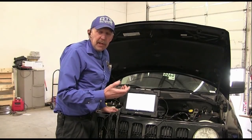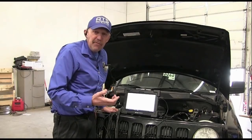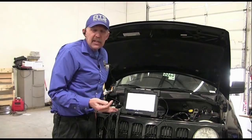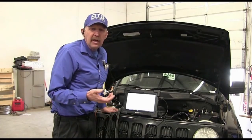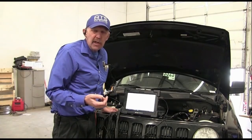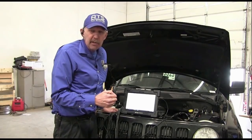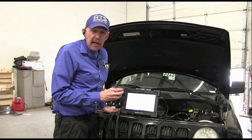And they knew something was coming out of a battery and going back in, and he basically had a 50-50 chance to guess what's coming out and going back in. So he says that it's coming out the positive post and going back to the negative post. The conventional theory of electron flow that we all use today. But in reality, that's wrong. The electrons are going from a negative potential to a positive potential. And in most cases, it doesn't matter. But in this one, it does.